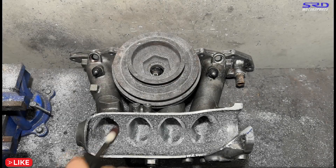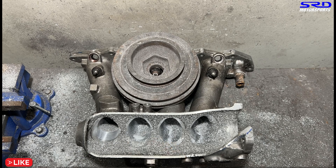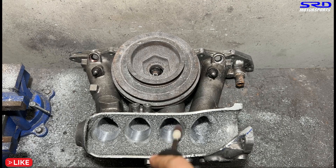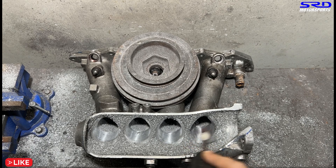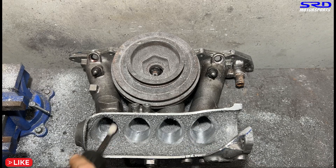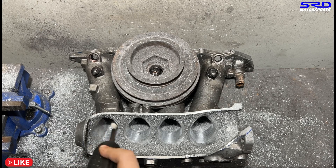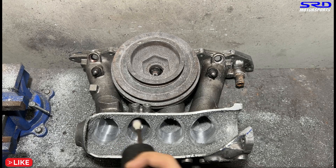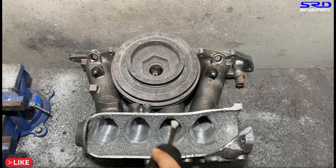Now we go with 80 grit. We spray a bit of lube just to get it all good. As you can see, it's starting to get the shape good — it's starting to look cleaner because it's bare aluminum that's clean. No more carbon buildup. Runner number one is next. Let's go one more pass because I'm still not satisfied. I can actually feel it, so it needs more passes until it gets a lot more consistent. Now it's getting more consistent and looking good. We've gotten deeper — this is about three inches now deep into the runner.